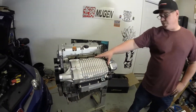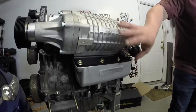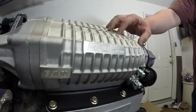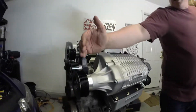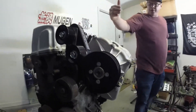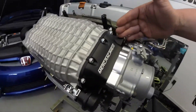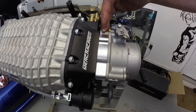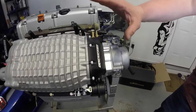When you purchase the TVS 1320 kit it is going to come with the manifold, the appropriate base plate, and the supercharger itself. This one is made by Harrop — you may see some Magnuson cases out there as well, but those were an earlier generation. The supercharger comes with the Stage 1 pulley, which is a 3.5-inch diameter pulley, and it does come with the Merck Racing 74mm inlet. The inlet comes with the option of a 74mm drive-by cable adapter, the K20 or K24 drive-by wire adapter, or the J37 adapter. All of those components come with the kit.